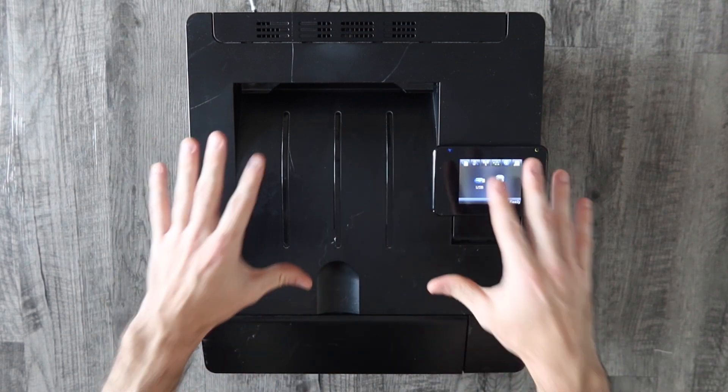Now we're going to go over to the wireless router. On the side here I have a button that says WPS. I'm going to hold this button down — for this specific Asus router it makes the power button start blinking. Your button may be on the front or on the side; you might want to consult your router's manual or Google if you don't know where your WPS button is. If you have a mesh router like an Orbi, there may be a sync button on the back, and you're going to press and hold that until you get some pulsating lights, meaning that you've opened the WPS connection.